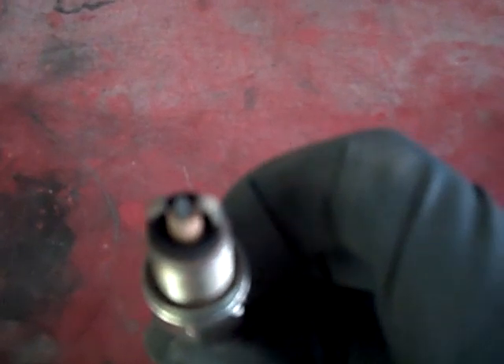On this one it's got a 3.4 liter. We're doing a couple of things on it — we're doing a tune-up. It's got to have those special plugs with the double ground strap. This is what they look like when they need to be replaced. This had codes P0306 and P0303 — misfires on both of those. You can see it looks like a knife blade in the middle instead of being square.